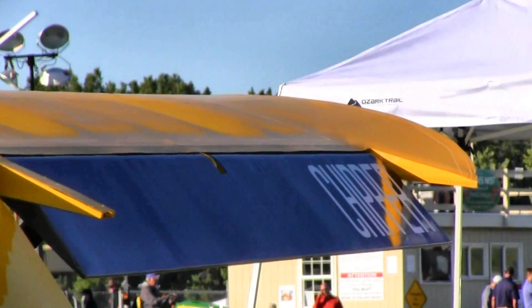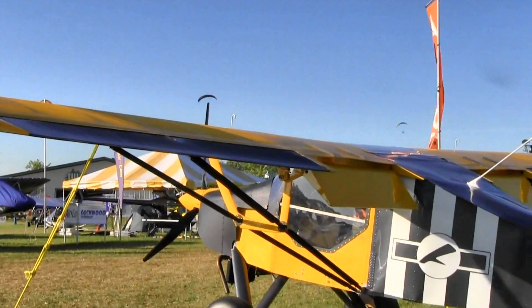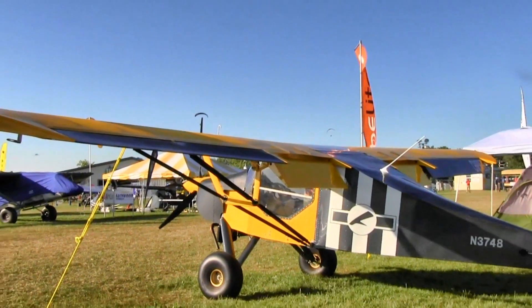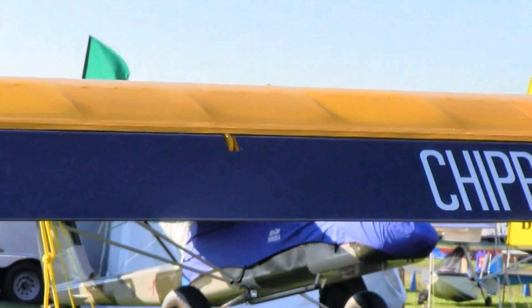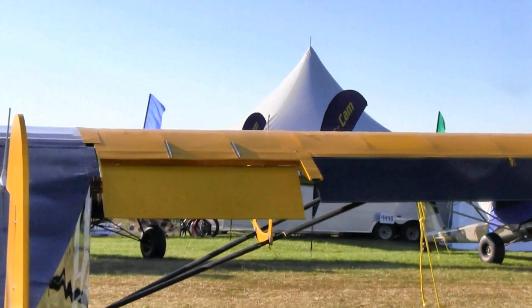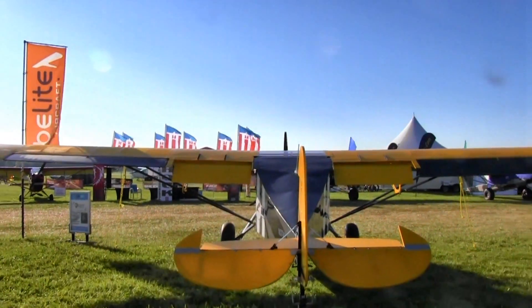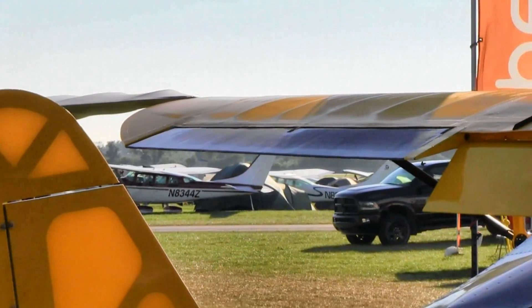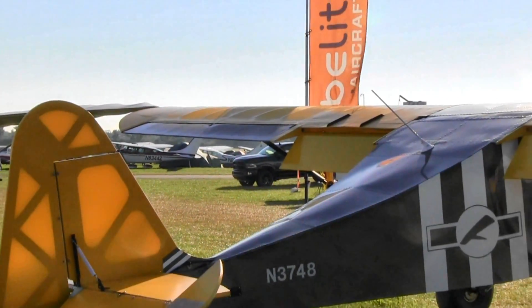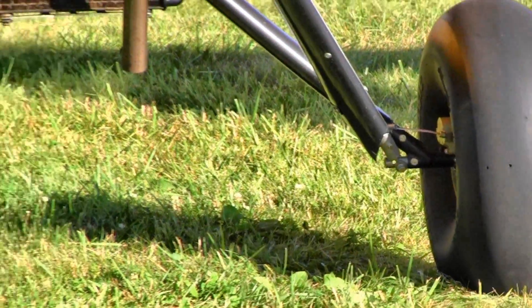The proof is in the performance of the airplane, and I've been showing that off this week and having a blast. My takeoff rolls have been running about 125 feet — granted with just one person in it, but on a fairly lumpy grass runway. We've been flying off this runway and my goal every time I take off is to be at pattern altitude, which is 300 AGL, by the time I hit the end of the 900-foot runway. I'm doing these wonderful VX climbs, just pretending I have a 300-foot tree at the end.